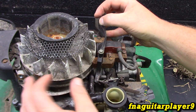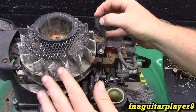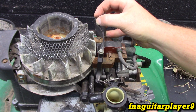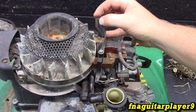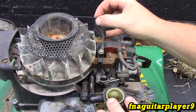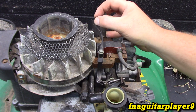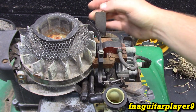So you get into some heavy grass and your RPMs start dropping, so the airflow starts dropping. This is going to come in just a little bit due to the spring tension to give it more throttle to regulate the RPM. That way, when this is dropping, it's maintaining the RPM, thus letting the carburetor compensate for the loss of RPMs by giving it more throttle, and it regulates the RPMs.